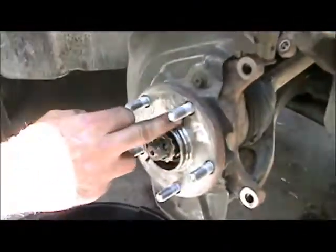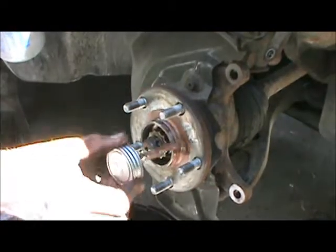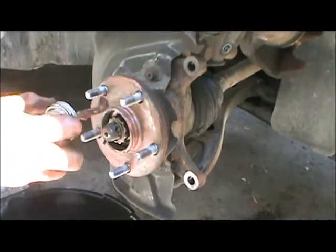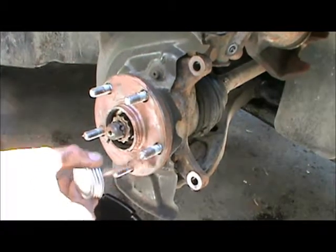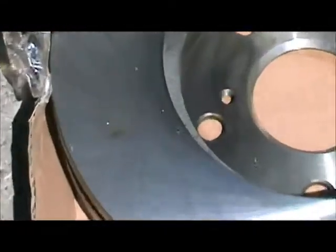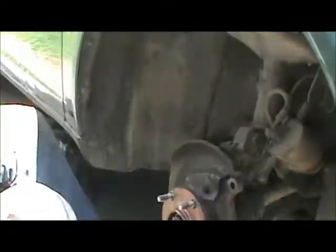One future preventative thing I hinted at earlier: the brake wheel hub surface — it's nice and clean, as it's been for many years on this car. We're going to put a little anti-seize around the center so the brake rotor will come off in the future no problem. Put a little bit on the surface here as an anti-corrosive — but don't go too crazy, because as the wheel spins it's going to try to fly outwards and you don't want to get it all over the brake rotor surface. Now we take our nicely clean brake rotor — see I got a spot on there from something — a little bit of diligence. Make sure we get that off. Never hurts to over-inspect.